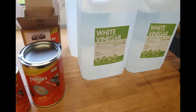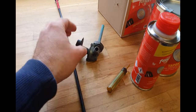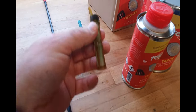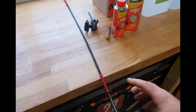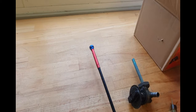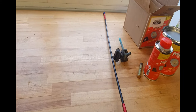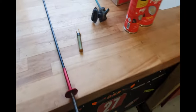We've got 20 litres of white vinegar. We've also got a new petcock tap and fuel gauze on the way — it hasn't turned up yet because this has all fallen apart inside the tank. I used this fantastic magnetic flexible claw tool to drag the old filter gauze out of there, which as you can see is completely finished.